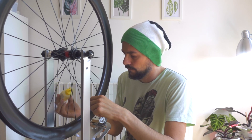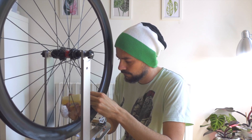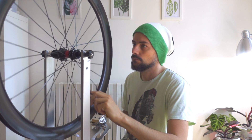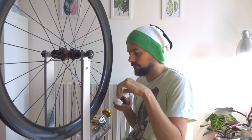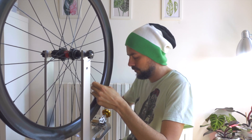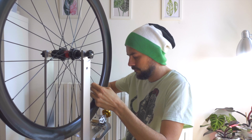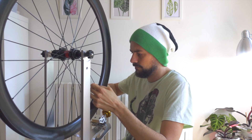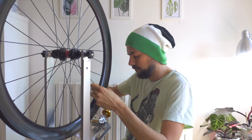As a first step, use some kind of lubricant to lube the nipples — it avoids the nipples from seizing and makes the tensioning process easier. Start tensioning each spoke by the same amount of turns. Using 18mm double square nipples, I applied a lot of turns before the spokes started to show some tension. In my case I did 4 turns all around twice, and then an additional 2 turns after that.